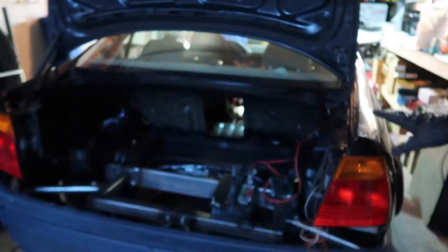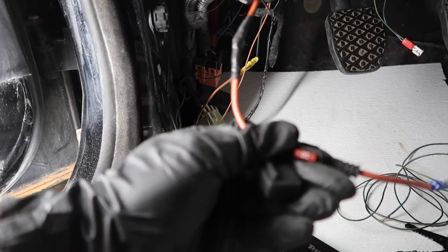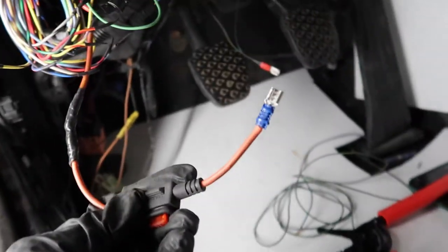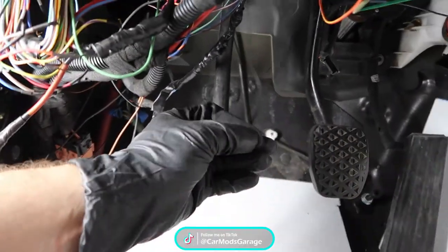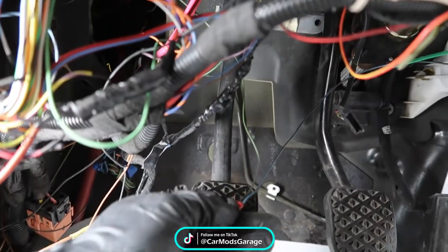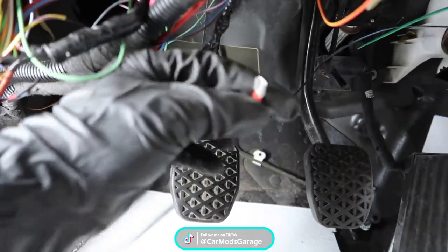Alright, finally done. I have extra wires because I still have to tuck them in, but I got this positive here and I put a 10-amp fuse and a connector. So I crimped this in there. I also got the two sides — the BMW one side is black and blue, the other one is black and green. I got them all together and I'm just going to plug in there.